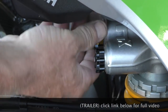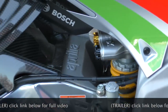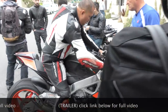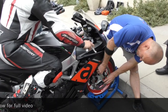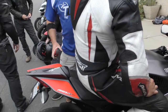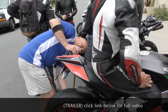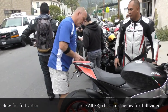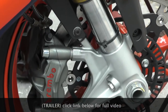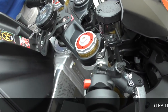How aggressive is he? He's not super aggressive but he can move along. That's much better — a 17? Feet up. About 1,600 miles, so it's still brand new. How aggressive are you with it? Does it go to the track? Yeah, I'm going to Green Mountain next week. Great track, that's going to be a ton of fun. If you go deeper than that, you need to take a 17 millimeter wrench or socket with you and add one turn clockwise on each preload adjuster, because your ability is getting better than the setting.